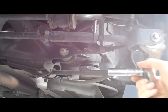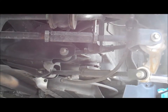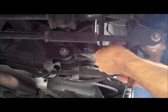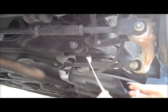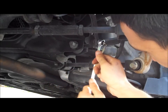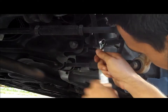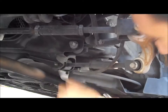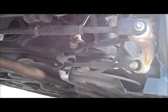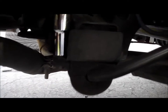I'm going to go ahead and remove the bolt here. You're looking at it from the back of the car to the front — the bolt's right here. Put your 14mm in and go ahead and turn it. So you've got your 5mm Allen, put your 14mm wrench on, put the Allen right in the middle of the bolt, just hold it, and it'll slide out. Take off the bolt and your end link is done. We're going to use the 12mm deep socket to remove these two bolts. Rear sway bar is completely removed on both sides — remember you just have to repeat the process on both sides.